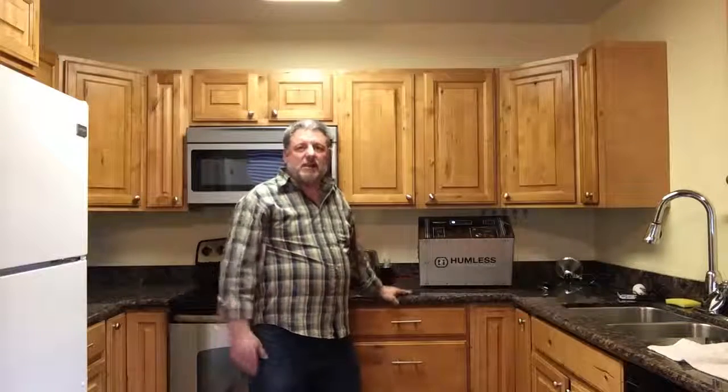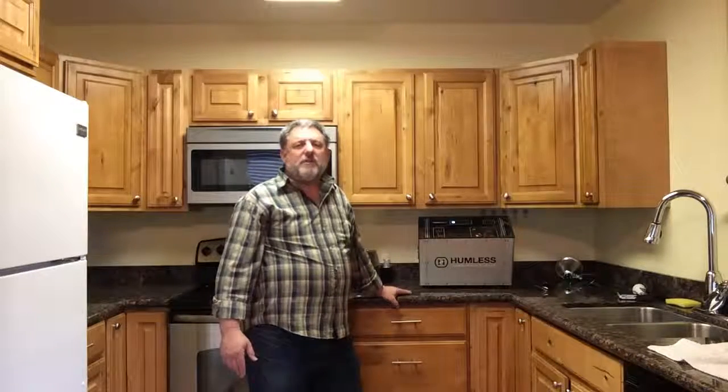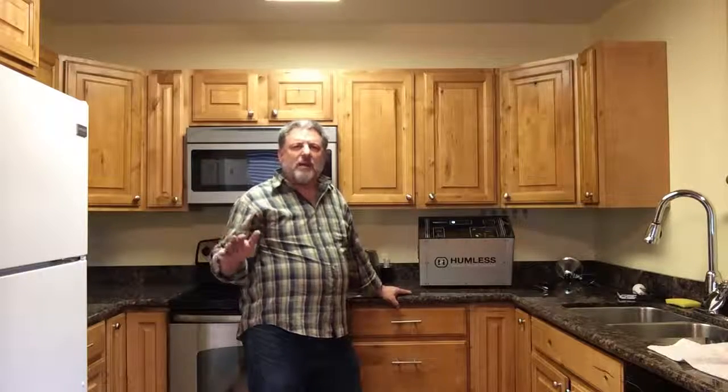So, other things that it can run. It can run a refrigerator, and I'll show that and how much it draws. Refrigerators are a funny beast, and I'll tell more about that, but they cycle the power, meaning it'll be on for a while, it'll be off for a while, it'll be on for a while to maintain that temperature, then it'll cycle off. And so it'll draw very little power when it's cycled down, but when it kicks up, then it'll juice up again and run the compressor and condenser unit on the refrigerator. And so it's difficult to tell when you plug it in how long it's actually going to run for, because it's doing that on-off stuff. And the more you open and close the door, the more it'll do that, right?